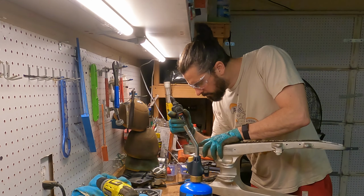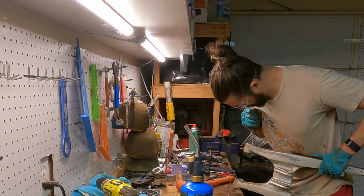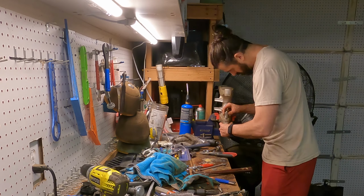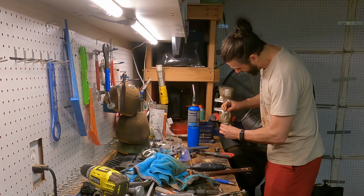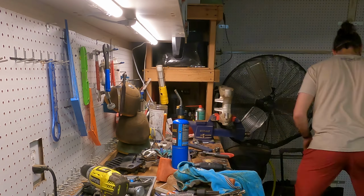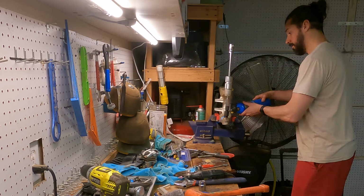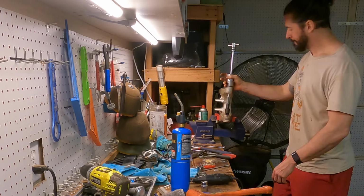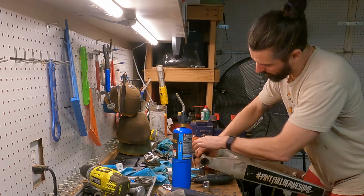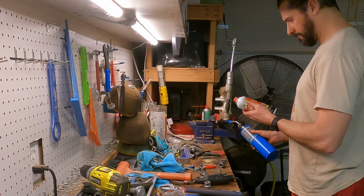Now that the Dremel tool has come out, you know it's getting serious. The problem with the Dremel tool I have is that the bits just aren't strong enough for the metal of the bearings. Back to trying to heat and press the bearings out with a long bolt and sockets. Then it was back to the slide hammer for a few more attempts. At this point, I have been in the garage for 8 hours and I was pooped. So I shot some rust penetrant into the swing arm in hopes it would work to loosen up the rust some.